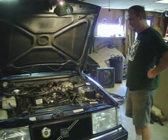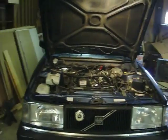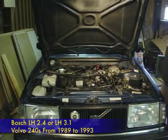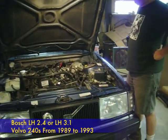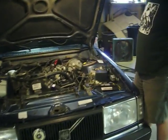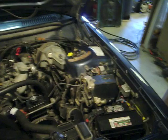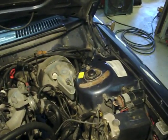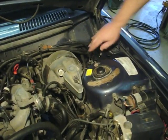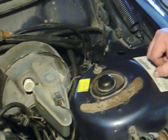We're going to show you how to read diagnostic codes on a Volvo 240. If you've got a Volvo 240 that is 1989 or newer, it will have the 2.4 fuel injection system, which has a self-diagnostic system. It's a primitive system by today's standards, and you don't hook it up to a computer to read the codes. Instead, there is a little box here on the driver's side fender up on the brake booster, and you can retrieve the codes by observing a flashing light on here.